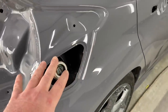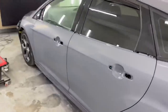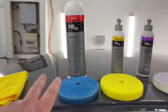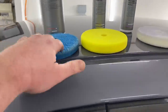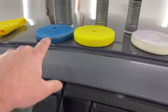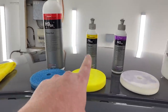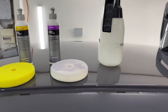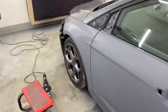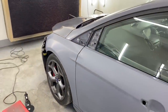That's all matching now. Once we put all the filler neck and everything back in there we can do that. I'm setting up now - going around this side today with the Koch Chemie trio, and these are all Rupes pads. There's still plenty of life left in that one - I've got another one anyway. So H9 for the cut, F6 for the medium, and M2 for the finishing, and I'll panel wipe in between every set. Going to make a start now on this side.